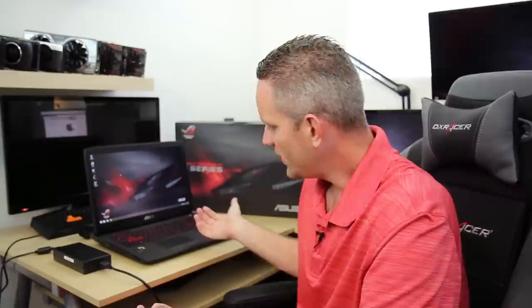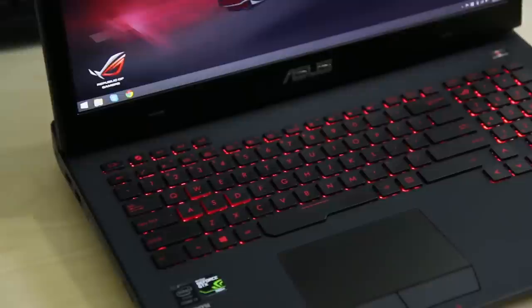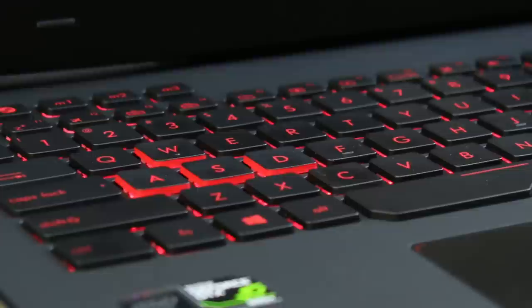The keyboard is red backlit, which fits the ROG theme. Like most notebook keyboards, the keys are flat and very shallow. If you're used to a standard membrane or mechanical keyboard, it's going to feel a bit weird going back and forth until you get used to it — that's more the flat key versus concave key difference. Once you get used to typing on it, it's really not bad. All keys are responsive, no skipped or double presses, very solid. It will depend on how hard you type for longevity — pound on it hard and the membranes and springs will start becoming sluggish.